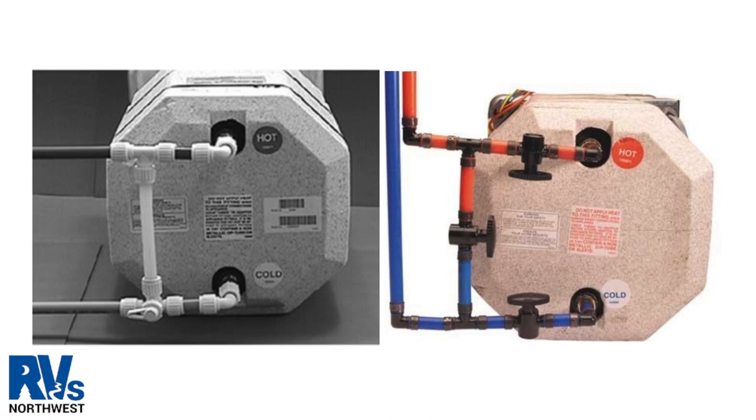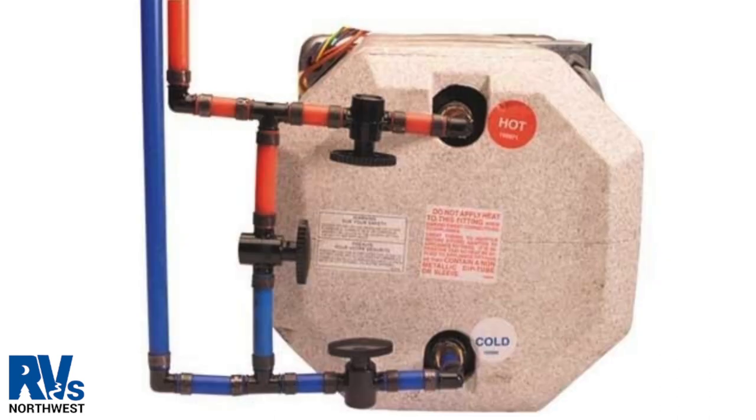These are two different types of water heater bypass valves. Bypass valves, if so equipped, are located on the back side of the hot water heater, usually on the interior of the RV behind an access panel. Water heaters with a bypass for winterizing will contain a triple valve or single valve with a check valve at the top of the tank. With the triple valve, you will need to close the hot and cold water valves, leaving the middle valve open to allow antifreeze to flow through the hot water lines and out the faucets.